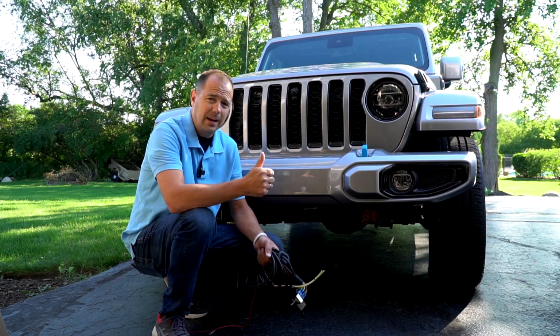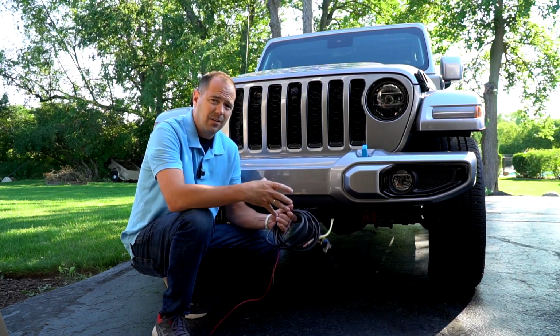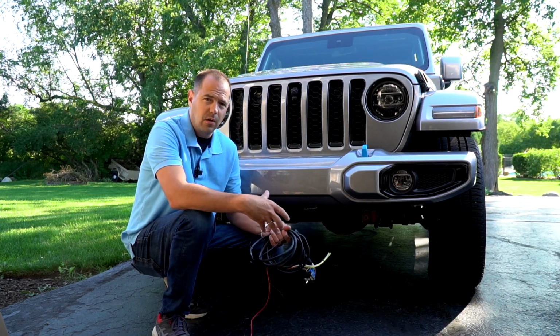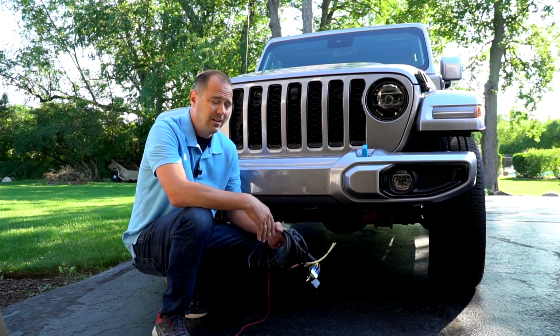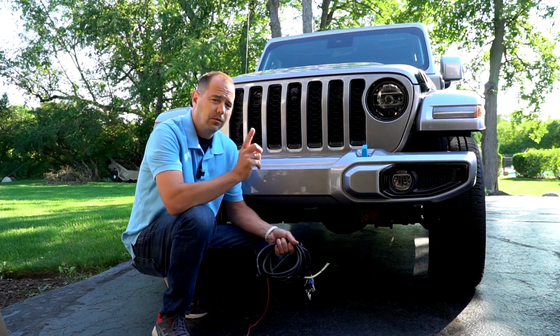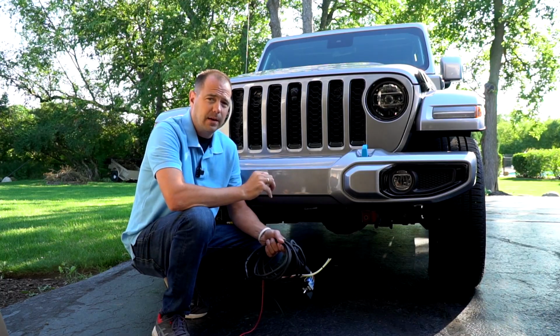You will not gain any miles on the vehicle while it's being towed behind the RV, and it disconnects the transfer case from the tires. So the regenerative braking system that's all in there happens after that, so it's completely disconnected. If you were to try and do something differently, you would cause severe damage to the vehicle. So always check your owner's manual if you're unsure, but that is very, very bad advice.